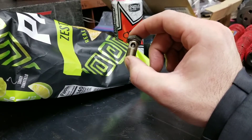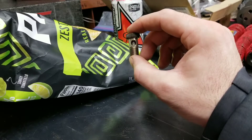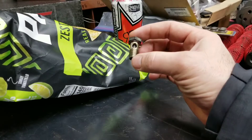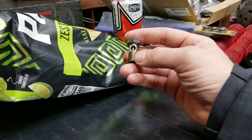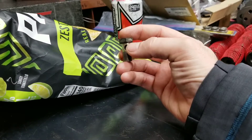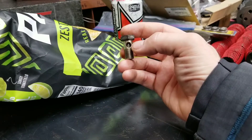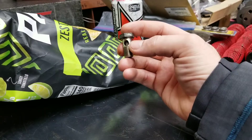Why is there a screen inside it? Because almost 20 years ago, in Subaru's infinite wisdom, they decided that they didn't want little bits of debris to travel through your oil system and contaminate various components inside the car. The problem with these screens was they were considerably smaller filter elements — as far as the actual passages through the filter — than the oil filter in your engine, meaning little micro debris that makes it through the filter would get stuck in these.